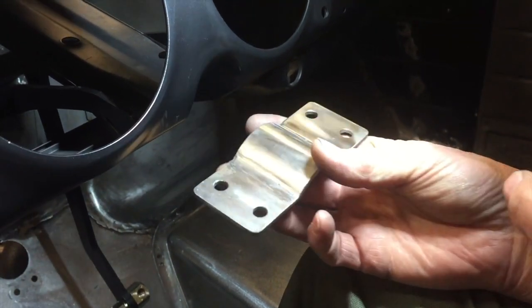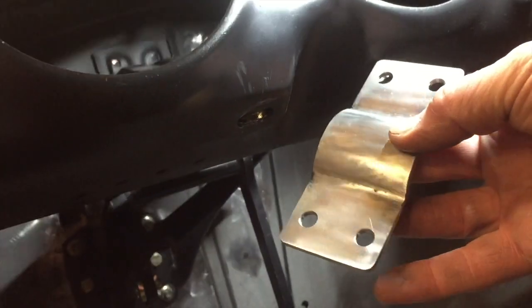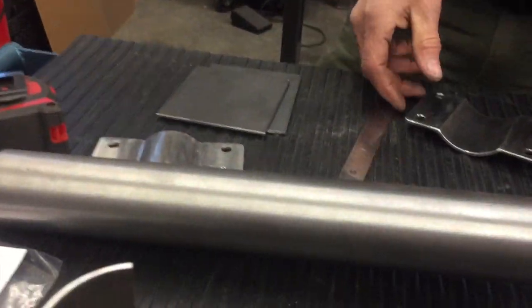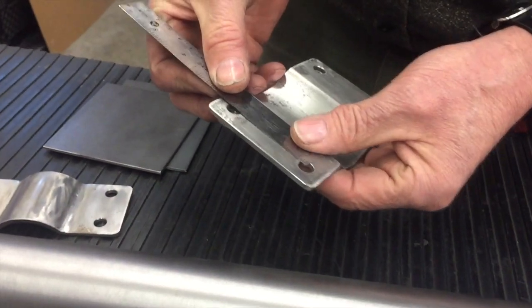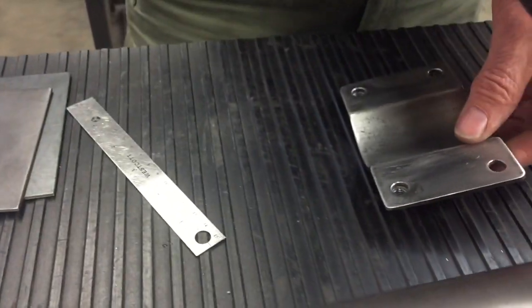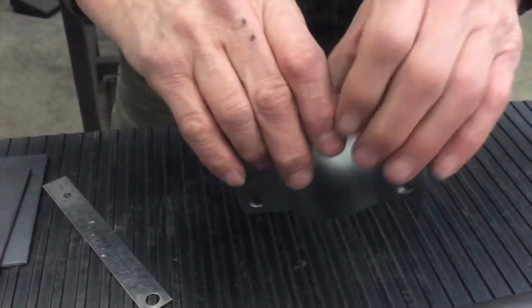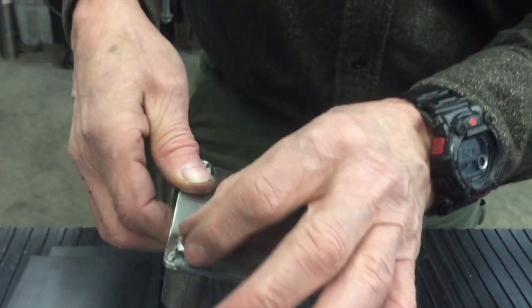I did that, and what I discovered was this dash kind of goes straight for quite a ways, and it didn't give me enough room to get a nut on top. So I needed to move it back farther. Version 2.0 is two inches center-to-center — I moved this back two inches from the front of the dash. And I welded some nuts on there so that I could just thread a bolt in and I wouldn't have to fuss around with a wrench.